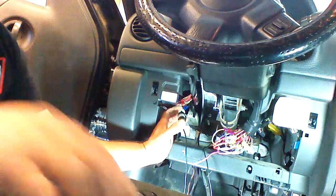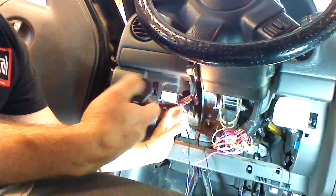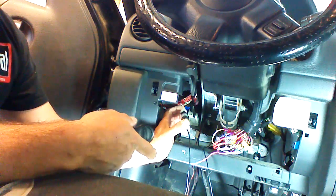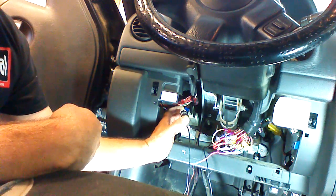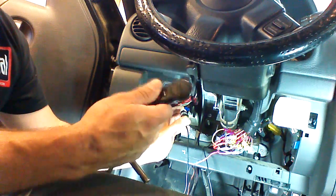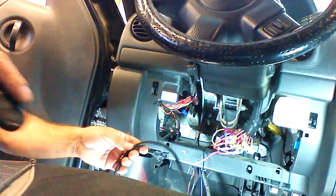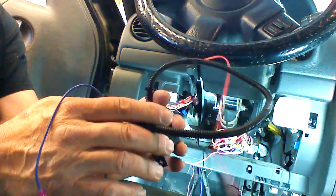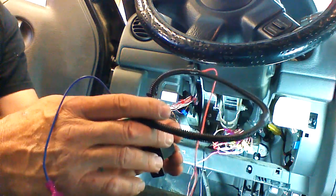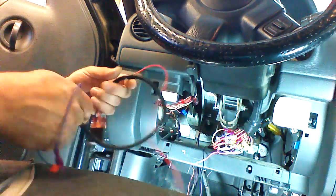And we're going to lock the doors. This will trigger the actuator. This is our door lock motor wire. We're going to connect to this wire so we can do 3-press activation from the OEM remote on this vehicle. Remember, this is an older vehicle. It's a 2003. So we've got our optional relay that'll come with your kit if you order just the OEM remote activated version. It'll be an actual option you can add on.